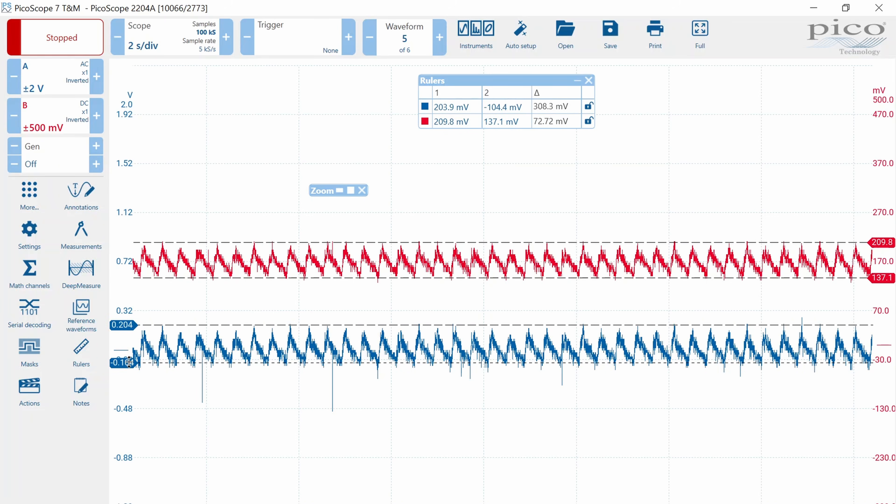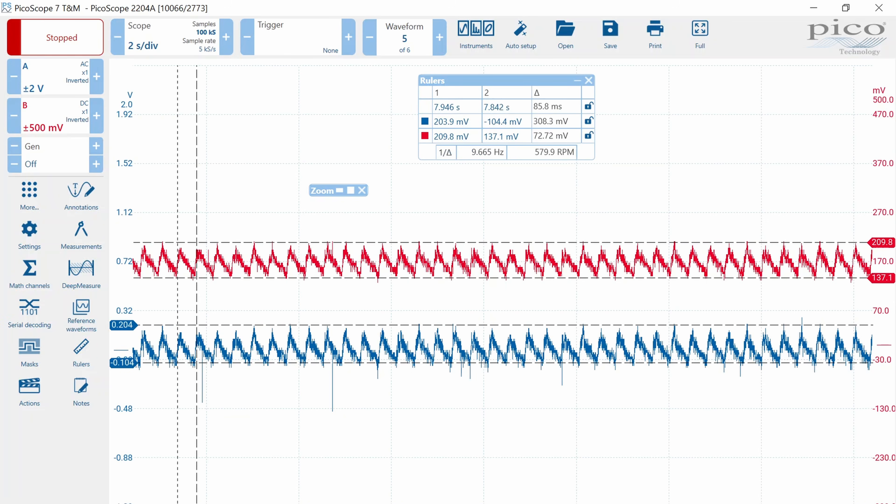When I look at each hump — I have a six-cylinder engine — I'll pick one at random right here and go over six humps: one, two, three, four, five, six. I go into the valleys of those humps, and I have a complete exhaust, compression, exhaust, compression, exhaust, compression, exhaust, compression sequence. Every time the starter is turning over, these peaks — the higher amperage draw from the starter — is when we're under compression.